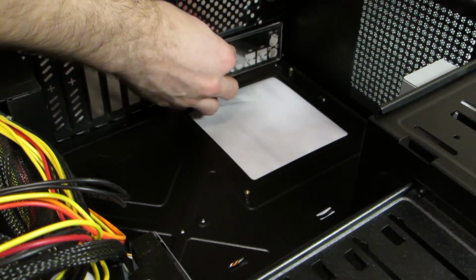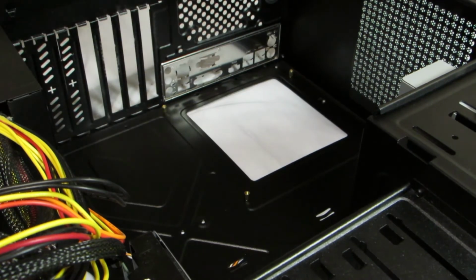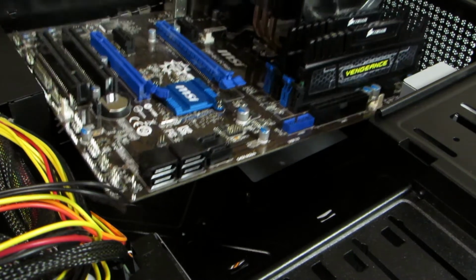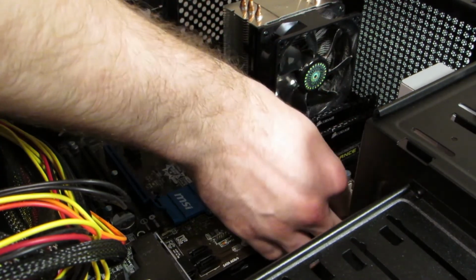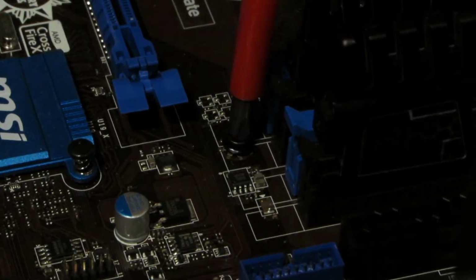Placing the motherboard. Push the metal tray into the back of your case as shown. Then ensure that the risers are fitted in the same place as the screw holes in your motherboard. Once they are all lined up to fit your motherboard, place it in and push it towards the back carefully till all of the ports can be accessed properly from the rear. The screws will line up if done correctly. After that, simply screw it into place.